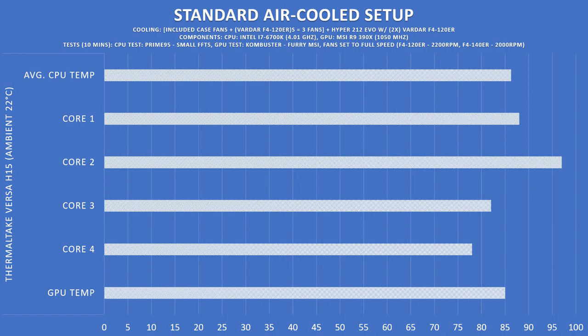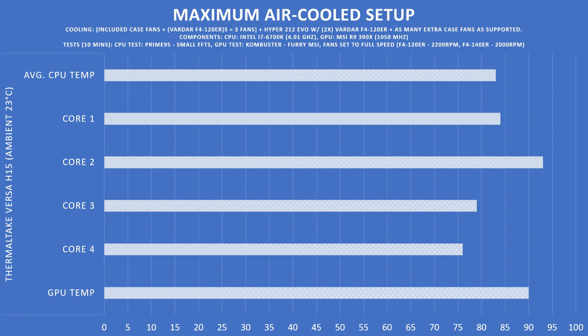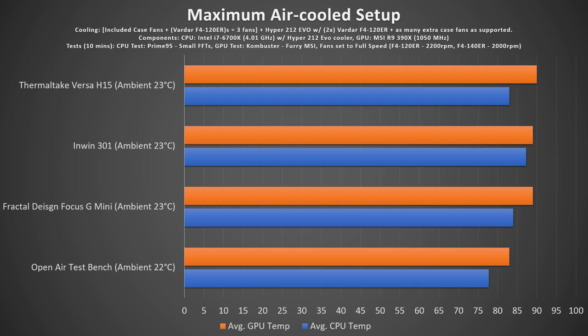Before we check out the final build, let's check out the thermal testing results. With just the two front case fans and a rear case fan under the testing conditions, the CPU maxed out at 86°C and the GPU maxed out at 85°C. Compare this to previous cases I've tested and you can see that this stacks up very well — I feel this may be down to a combination of the full front ventilation and the light front foam filtering. However, adding two extra fans to the top seemed to help the CPU reduce its max temperature by over 3 degrees, but the GPU increased its temperature by 5 degrees. I tried both two intakes, two exhausts, and one intake and one exhaust for the top two fans, but the latter turned out to be the best result. This increase in GPU temperature is likely caused by the top fans trapping air in the case, creating turbulence but not a lot of airflow. Remove the top two fans for the best result, and then you can replace them with the LED lighting strip that you couldn't place there earlier.